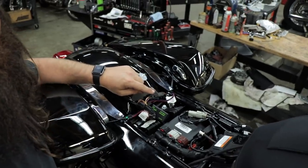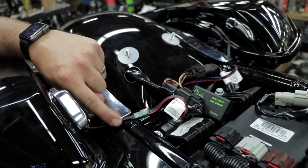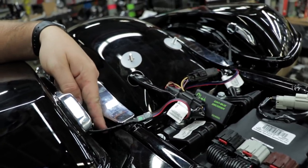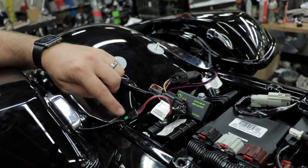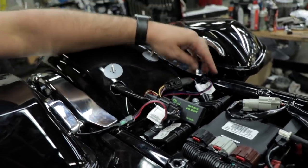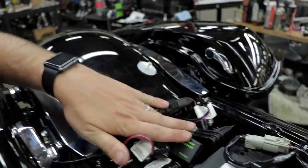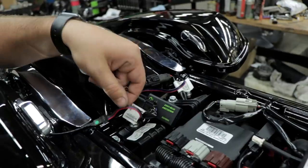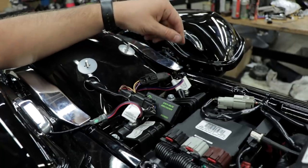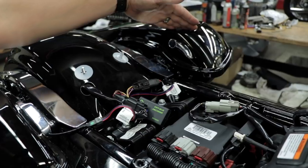The right side bag is plugged in right here. I kind of tuck it underneath this little piece so that when you do need to take the bag off, it'll pop right out and you don't have to take the seat off, but the connector isn't dangling around. On the left side I did the same thing, and I ran a zip tie around all this stuff to keep it centered so it's not sitting on top of any bolts. I left enough slack in each bag blade side-specific connector to pull it out from underneath the seat.